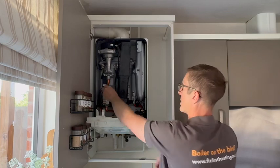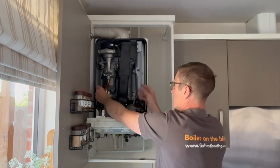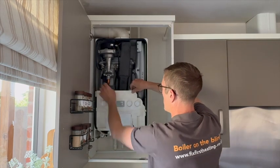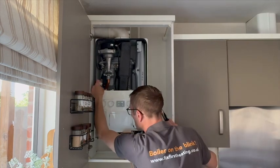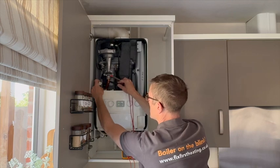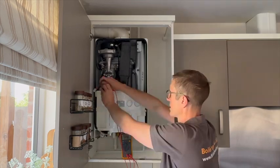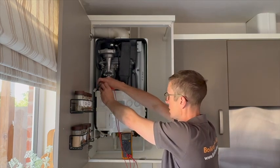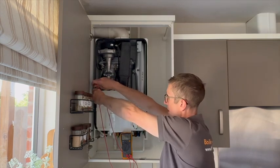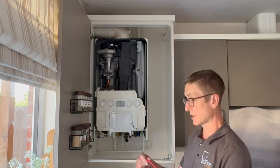What we're going to do is turn the power off, because what could be happening is that the spark generator might not be getting any voltage. We need to test whether we're getting voltage to that spark generator. Turning it back on — I can test it with my multimeter. We've got live on this pin — you can see the brown wire should be live, neutral is the middle one. Let's check neutral and see if we're getting 240 volts to that. If you're not getting 240 volts, that suggests a faulty circuit board. We are getting 240 volts.